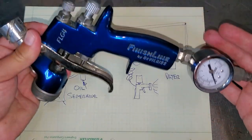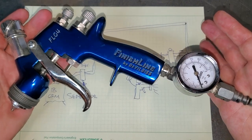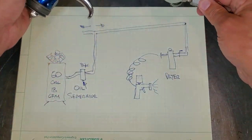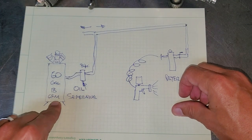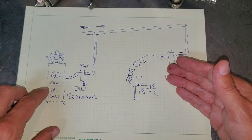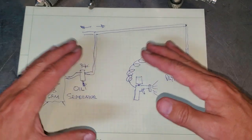Now, talking about guns — if you're shopping for a gun, I'll link below to my Amazon store where I got this. This gun has a CFM rating of around eight. You want to look at your gun's CFM rating because your compressor needs to be higher than your gun. This is an 18 CFM compressor. Imagine if the CFM was lower than the gun — your compressor would be running nonstop, putting a ton of moisture into the air, killing your dryer, and ruining your paint job. So keep that in mind if you're going to go this route.